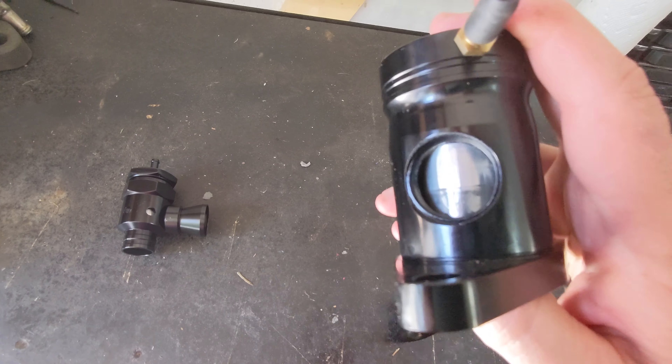I installed a front-mount intercooler and needed a new one that wasn't that specific, so this one is universal. A couple of cons right away: it has a smaller inlet than most universal ones, so I needed to buy a custom hose — one that goes smaller to larger for the normal 1.25-inch nipples left for blow-off valves. That's one con. The second is more minor: this blow-off valve cost $16, this one costs $31 because it's more specific — both on eBay.